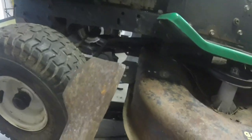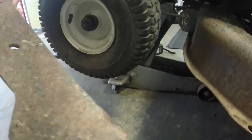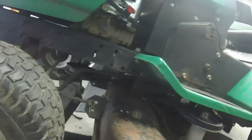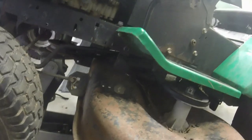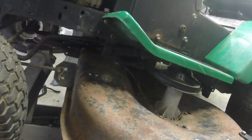Here are the blades again — you just take an impact with a 9/16ths socket and get them right off the mower. The lift is still good on them, the edge is still good on them. I'm going to touch up the sharpening a little bit — they really don't even have many chips in them, which is really good. I'll sharpen these, put them back on the mower. I already got the deck belt on. It's no tighter than the other one, so the old one was probably alright. Either way, this one will have a new deck belt and sharpened blades. We'll get it back on the ground and give this thing a final test.